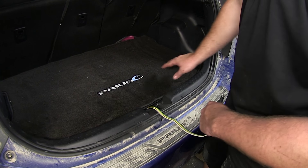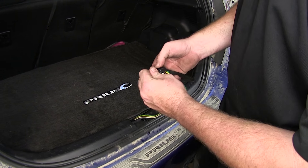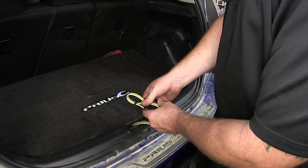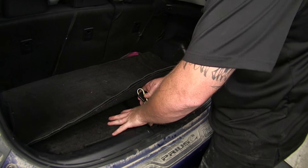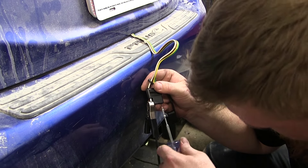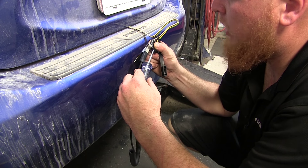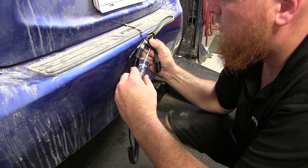Now with all the items back in place, we'll go ahead and attach the dust cover over the top of our 4-pole wiring so we can prevent any kind of dirt, debris, or build-up from getting on the inside. Place the cover over and then roll it up and store it on the inside until we're ready to use it. Now we'll go ahead and attach our ground and then test out our wires. Our brown wire is going to be our running lights, the yellow wire is the left turn signal, the green wire is the right turn signal, and then our brake lights. We're all ready to go.